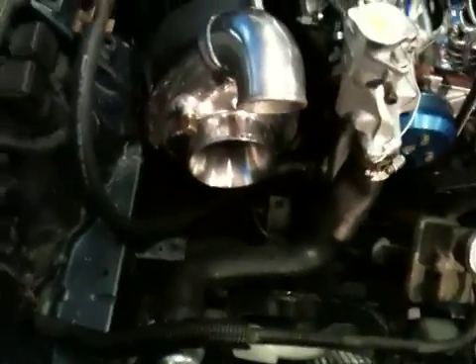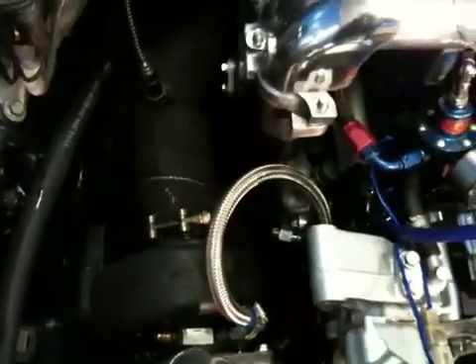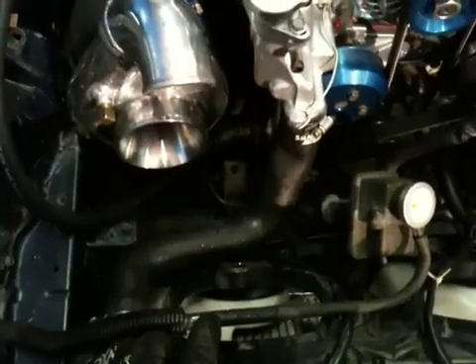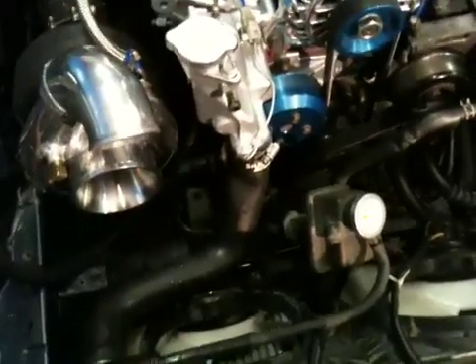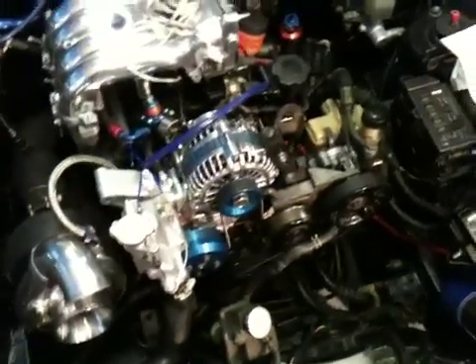I've been very convinced of its abilities. Not only does it affect the compressor map in a positive light — meaning it makes the turbo more efficient — but it also has a nice cooling effect on your exhaust gas temperatures. On a rotary, those are up at like 1600 degrees Fahrenheit. So detonation, combustion, all those crazy things that can happen get a little bit scary on a rotary engine. Water injection is definitely one of the holy grails of a solid running RX-7 rotary engine vehicle.